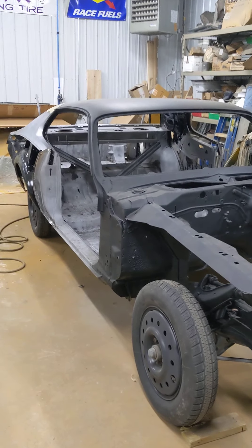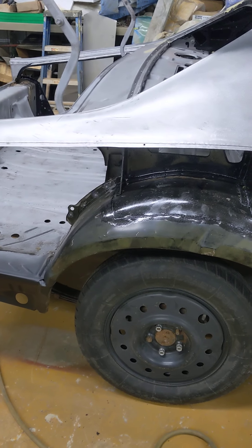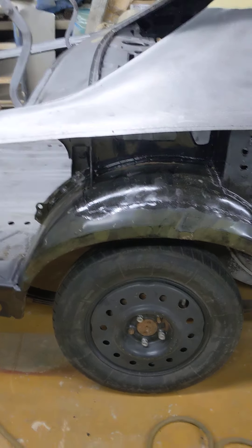I still got to do some stuff in the back, wanted to get that sealed up. And I had cut off the quarter panels because they were bad. We got that all sandblasted inside, got some primer and everything up inside there. And the wheel wells were all rotted, so I replaced the outer halves of the wheel wells.